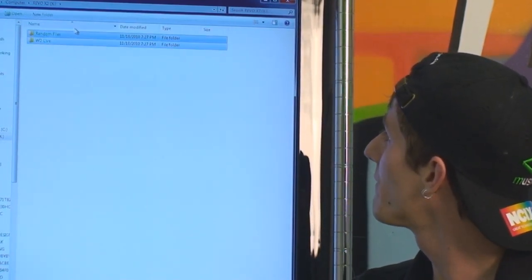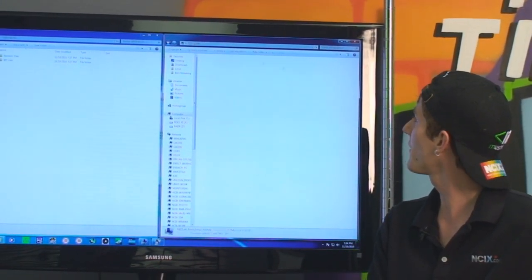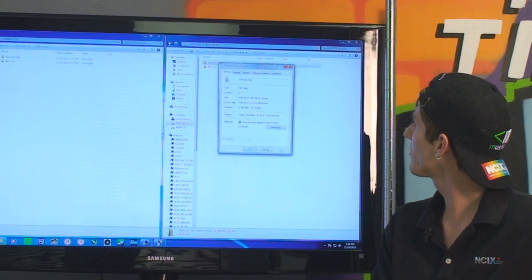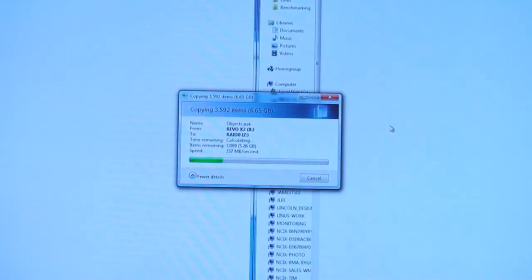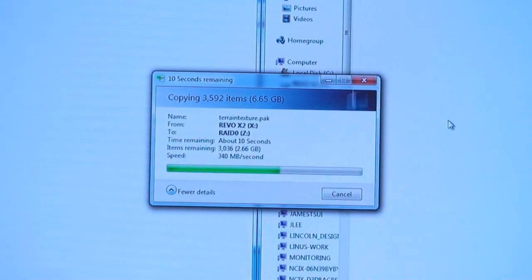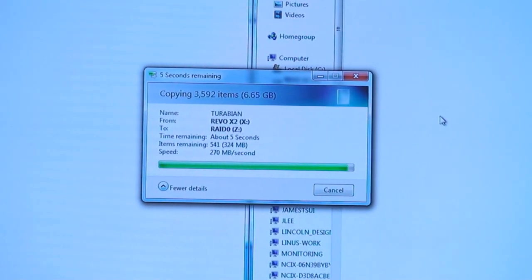Just for the sake of fun and games, we're going to do a quick copy paste. These are random files of various sizes, like game files — it's a 6.65 gig thing. Put on your timing hats and we'll find out how long it takes to copy from the RevoDrive to a giant RAID 0. I've run synthetic benchmarks on this RAID 0 and it comes up around 650 to 700 megabytes per second, but when copying little files you lose a lot of performance in the overhead. It's still going at well over 300 megabytes per second for most of it. And it is done just like that.